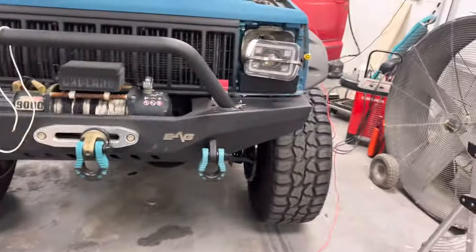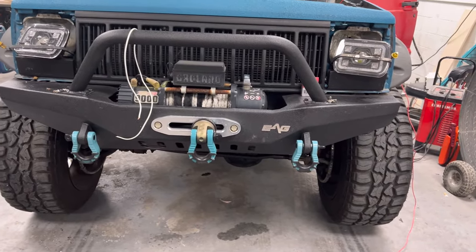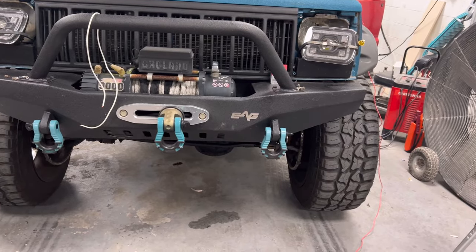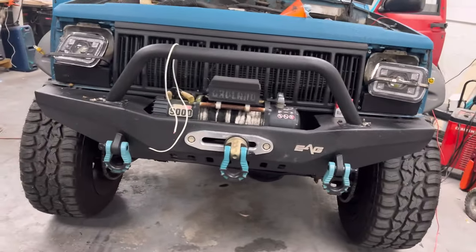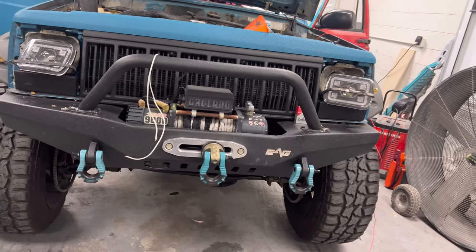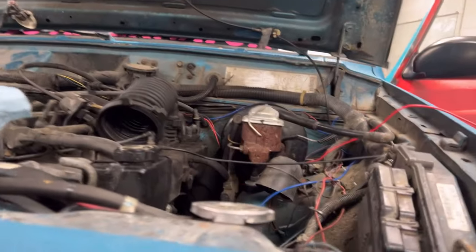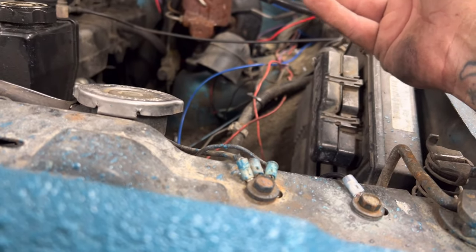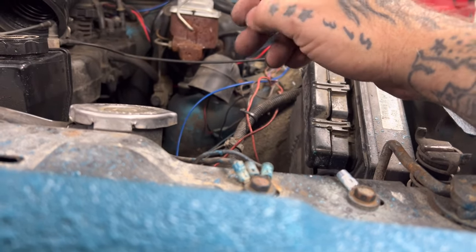It's just wild because high beam and low beam everything quit working at once — I've got power in and out of the switch. At another time, when I put my new alarm in, I'm gonna pull everything underneath this apart and check my dimmer switch on the column for high beam power. If I have it, I'm gonna run another wire from that to the harness under here, and at that point I'll have high and low beam. But for now this is my best plan of action.